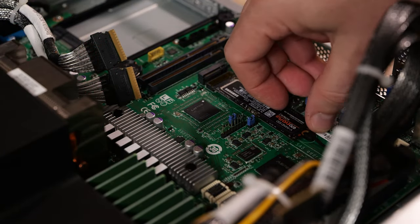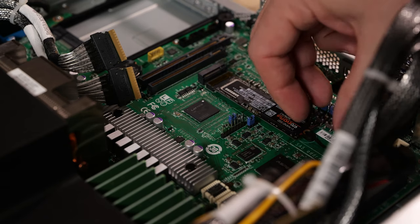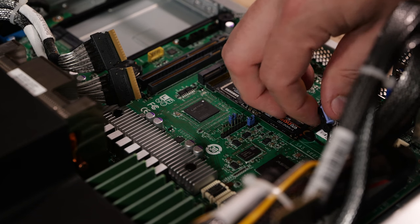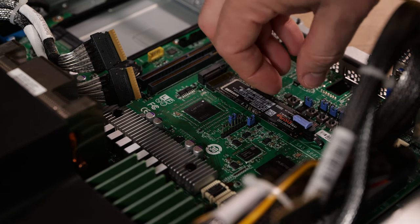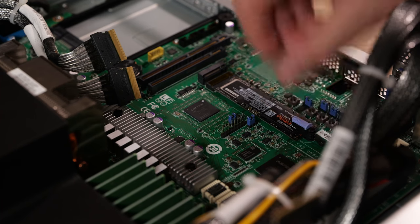If you are doing NVMe multi-tenant, like you're building a cluster and you're having your compute somewhere else and you're wanting to expose this as a storage device, chances are each tenant has one or a few M.2. You're not really going to bottleneck at 35 gigabytes per second, even though technically, yes, if you do the math, 3 or 4 NVMe running full tilt could theoretically bottleneck your 35 gigabyte per second overhead.